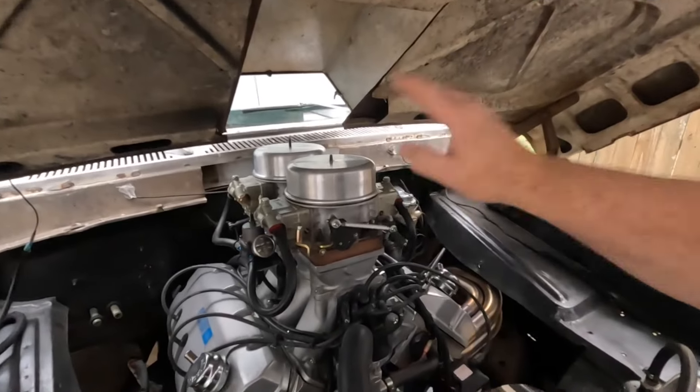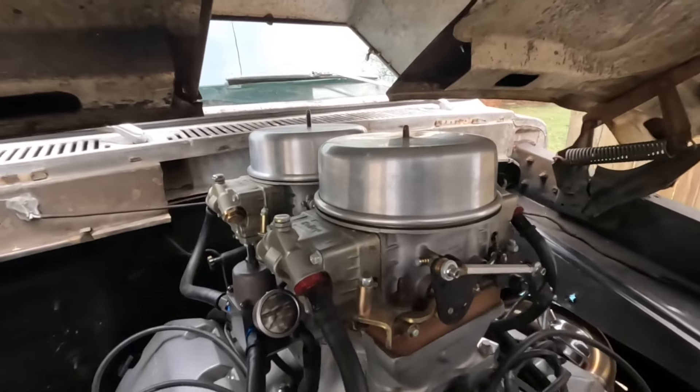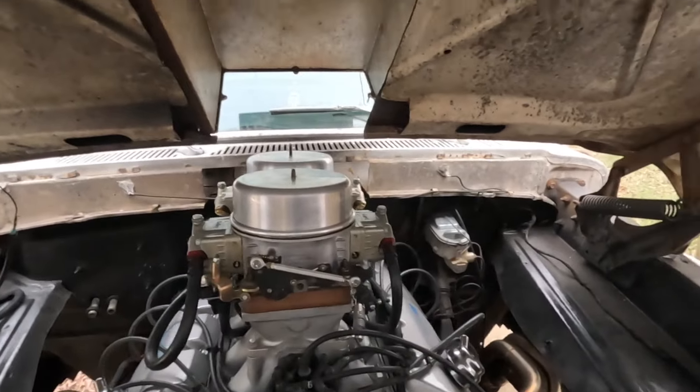Ever since I built Mixed Up Boss two to three years ago, every once in a while I get an email with the same question: how come you didn't use a 750 double pumper instead of doing the 750 dominators? Well, the dominators just look cool, and I wanted to see if I could tune dominators to be streetable — and I've done that. In fact they work extremely well. They are pretty picky when it comes to deciding which circuit they're going to operate in, and I will show you once these carburetors are off why that is, because the transfer slot in a dominator is not in the same location as a typical 4150.